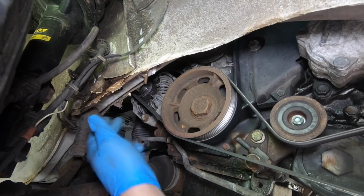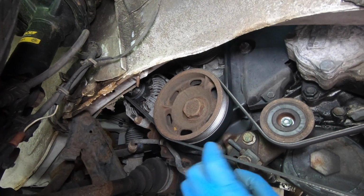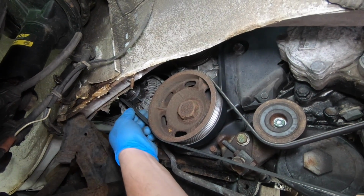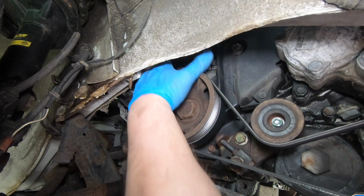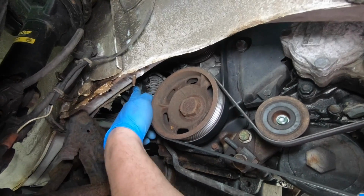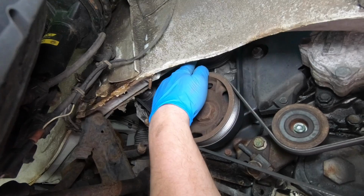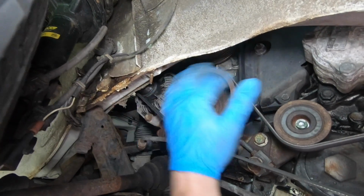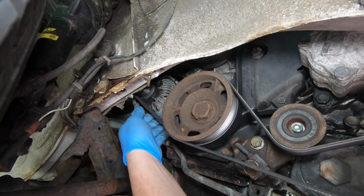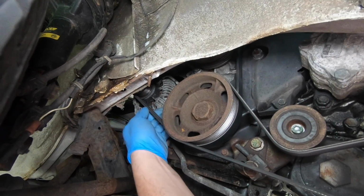Now, if that belt still squeaks when we start it up, we'll need to tighten it a little bit more. You can get tools to gauge them, but that's a rule of thumb: find the longest run of the belt. I think the top one's maybe the longest, but you can't get to it. No, it isn't, because you've got the tension in there and another pulley there. So the crankshaft pulley and the alternator pulley look like the longest ones to me. Well, they look fairly equal actually. But that's good.